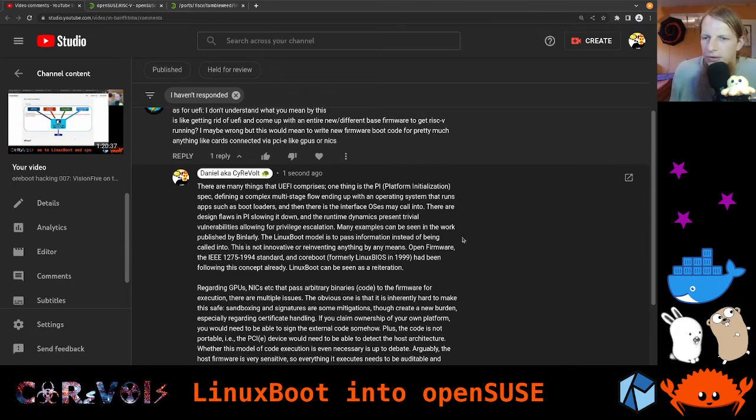One of the questions is whether we're really innovating something just for the sake of it. The answer is we're actually just picking up existing concepts. Having firmware based on Linux is what is now called the coreboot project — formerly LinuxBIOS — which was the idea of putting a Linux kernel in a SPI flash to bring up the platform. Back then hardware was simpler, so just using the kernel with a few changes was enough.